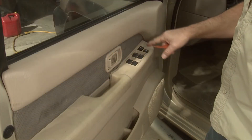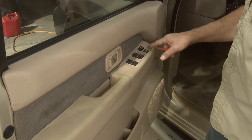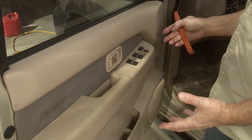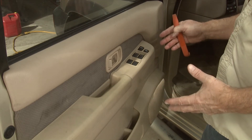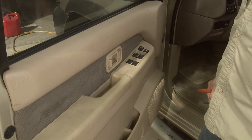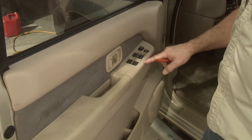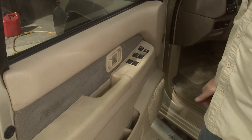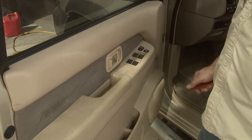This is going to take a little different tack to spray these contacts. In order to service this, it's not difficult — you do not have to pull the door panel off. One comment: in general, when you do electrical work on your car, you should disconnect the battery by pulling the negative terminal. We don't need to do that here, and I'm not going to do that, so that we can test the different parts as we go.